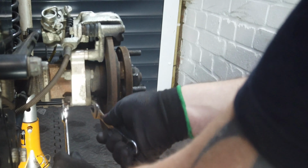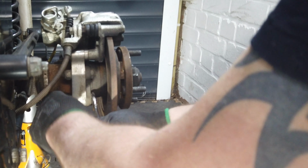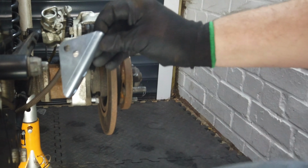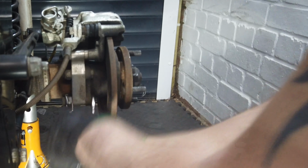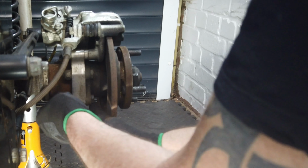Straight in with top tip number one for if you built your own car without the rear anti-roll bar. If like me you will have followed the instructions and only fitted the mount for the speedo on the driver's side. What I didn't realise at that time is the mount is also used for the mounting point of the rear anti-roll bar. Now luckily, as I'm a bit of a hoarder, I kept this mounting bracket along with all the other bits left over from my build. I was able to dig through the box of bits and retrieve the mount required.